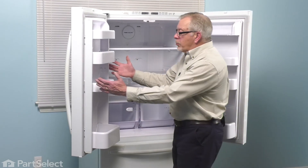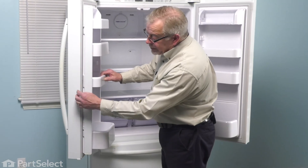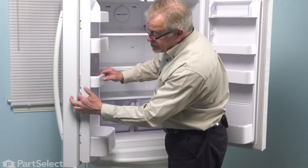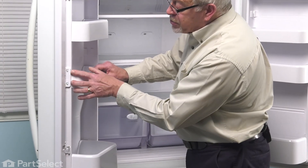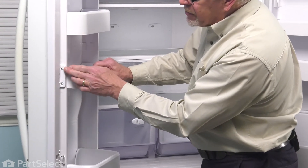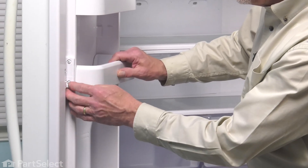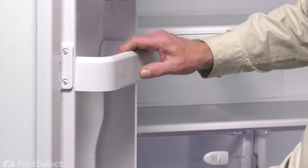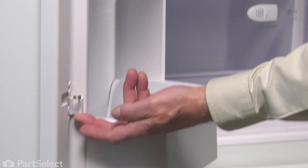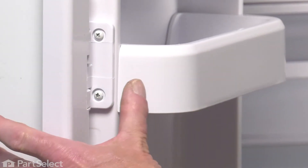If we're doing the left-hand door gasket, we have the mullion that we need to deal with as well. You're not able to pull that gasket away because there's not enough space in there. If we flip that mullion open, we'll expose two screws. Your model may have some caps over top of those screws. Simply pop those off, and then using a number two Phillips screwdriver, we'll remove those two screws, and then we'll press up on both the bottom and top hinge at the same time and release that center hinge, and then we can lift that mullion away.